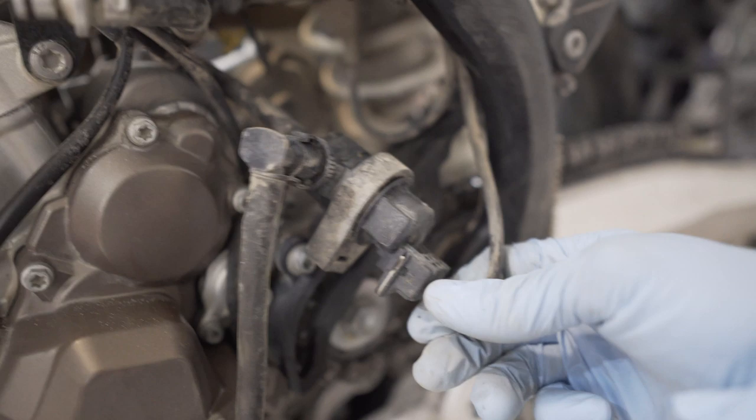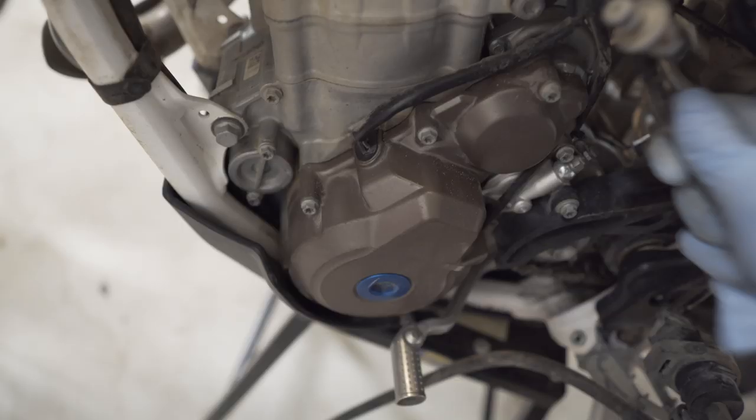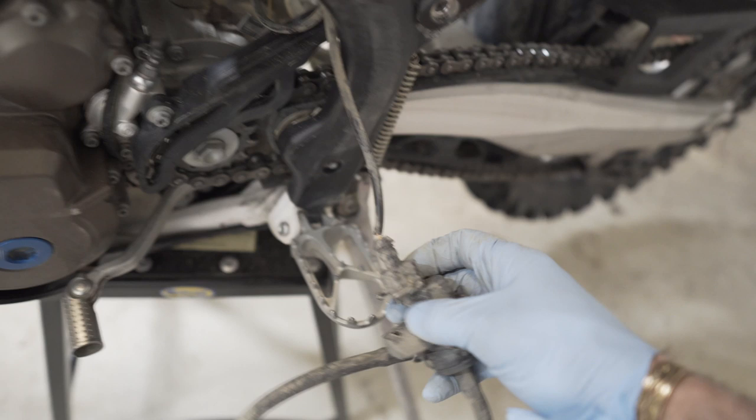And all right guys, I got the solenoid out. This line is out, but this other line that goes to this side of the valve is the one that runs into the throttle body behind that engine mount and is that little nipple that is not super easy to get to, but once you get back in there, let me see if I can see it. There it is there, right in the center. Once I take this mount out, I should be able to get into that nipple to take that off, to then plug that, take that tube off, and then delete that line completely out. So do that now. A little stuck. Alright. Got this.